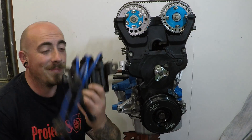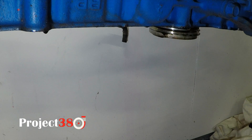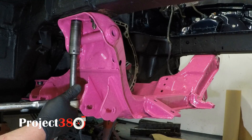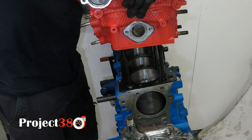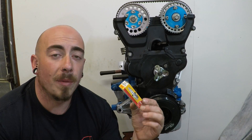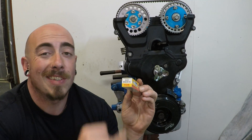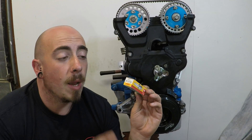Today it's time for an ignition upgrade. For the ignition upgrade I'm going to start off with the spark plugs. On these I'm going one range colder, so I'm using a BKR7E. I won't get into what all these letters and numbers mean apart from the 7.